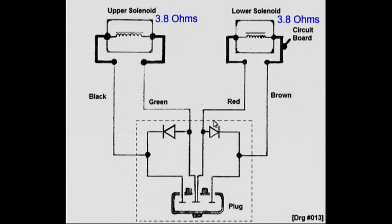This patched area represents all the components inside the plug. The flyback diode — through reverse engineering and trying to find out what was available — I've identified as a BYW32. When I repaired mine I put two diodes in, so there's a pair of diodes giving double the protection. The reason for the flyback diodes is to protect the engine management system from a reverse pulse. If there were a reverse pulse it would come down here and go round the circuit.